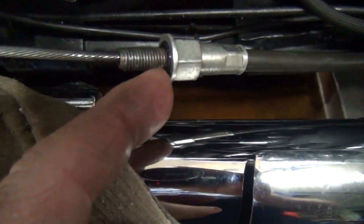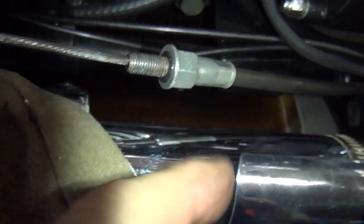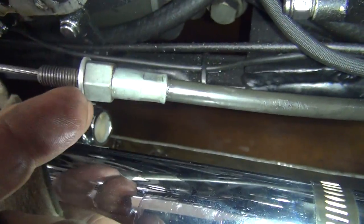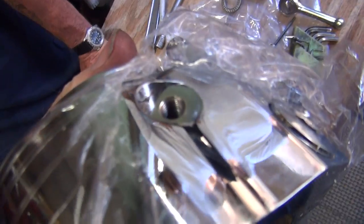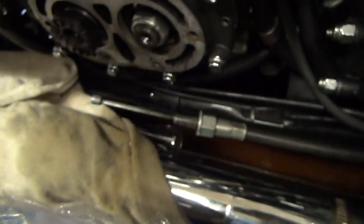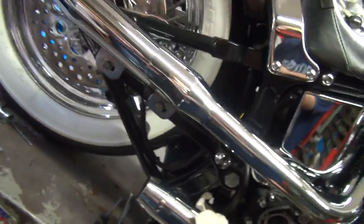So what I did was I took the O-ring, jammed it up on there, and I took a 12 millimeter aluminum banjo washer and I jammed it over the O-ring. So now we got a hard stop. So when you tighten this thing down hard like you're supposed to, then it will still have an O-ring seal in the middle to keep it from leaking. If you had it like they want here, you just tighten up until the O-ring goes squash, and at some point you stop between touching and squishing it in half and hope it doesn't ever move, which is bullshit. So that's how we do it. So now we're going to see if we can put it together.